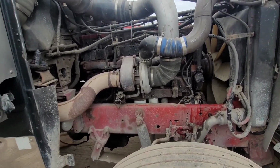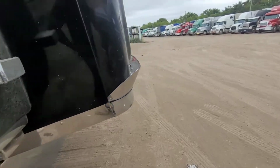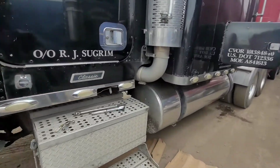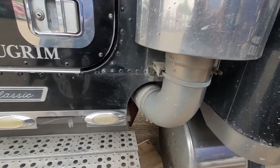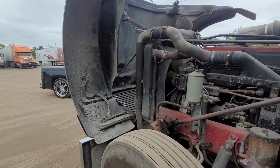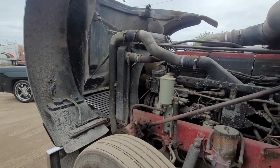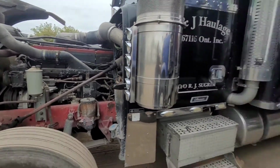Oil level was good. I'm gonna go down and I have a tranny cooler, so I'm gonna check the tranny cooler, see if there's any sweating on the lines, check the levels inside of the tranny, make sure that's good and didn't go down. Sometimes it could just be even dirt or just something from the rad causing that color of coolant, but I will keep an eye on it. She still runs and pulls.